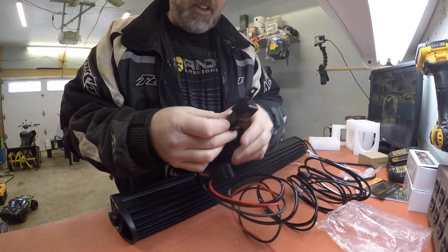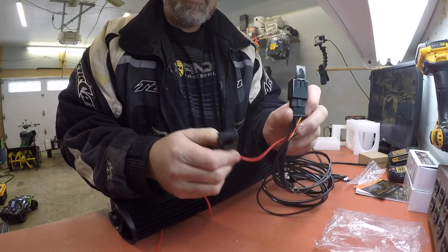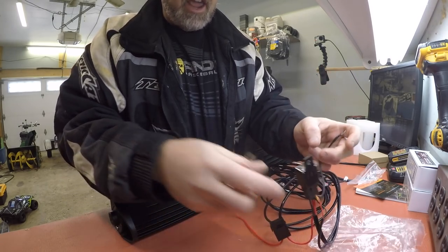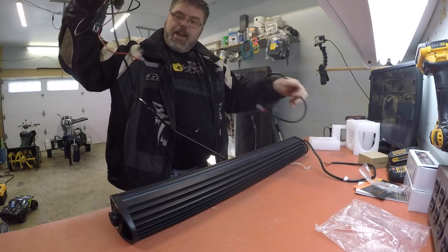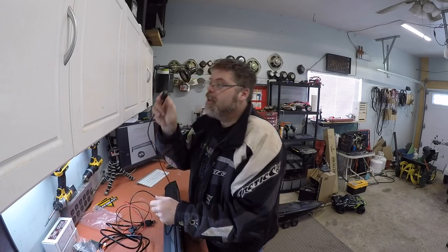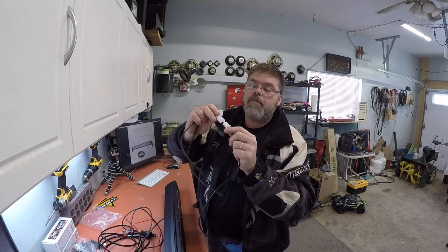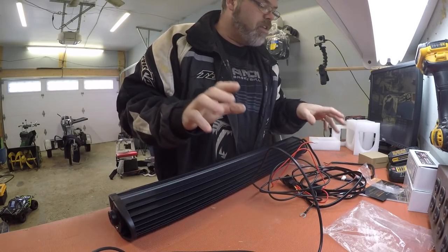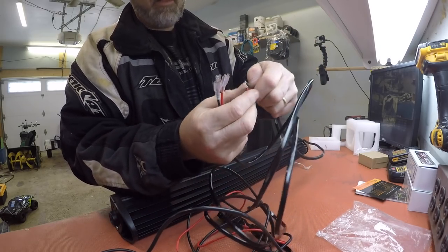Here's the harness this one comes with. This is what you need if you don't want to do a bunch of wiring. It comes with a fusible link and a relay already attached. All you do is take this to the battery — positive and negative on the battery — one lead goes to the light bar, and the other lead goes to the switch, which is on a plug. Look at the little switch. That's like the easiest installation ever. You can unplug it to run through the firewall and then plug it back in — and Bob's your uncle. The only thing I noticed it didn't come with is the clippies — one end has a clippy but the light doesn't. Anybody can buy a pair of clips though, no big deal.